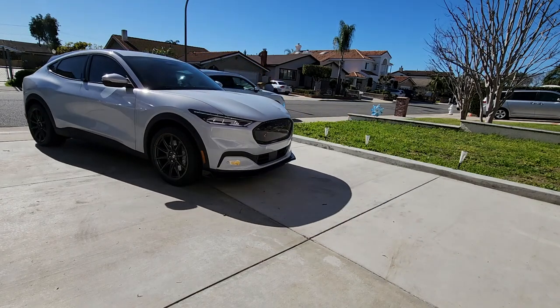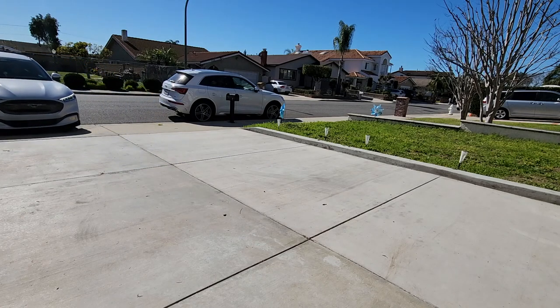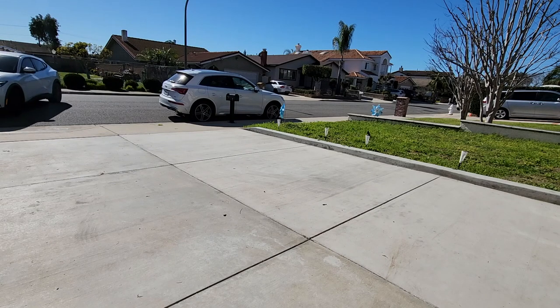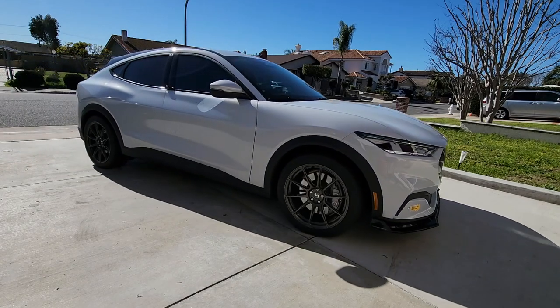Now I'm just pulling it out, doing a quick test drive down the road to make sure nothing feels wobbly or funny. No issues. You can go back around and torque again just to make sure if you feel like it — probably re-torque after a couple hundred miles. So that's my video.